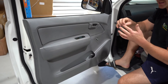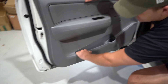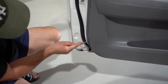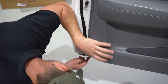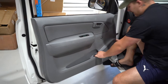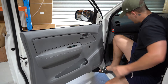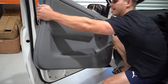Bring the whole coin pocket out, again making sure you don't lose anything. Now run your hand around the edge — be careful not to catch any glass on your finger and cut yourself. Then use a flathead, come over to the corner, and stab the flathead in the most hidden space possible without damaging anything. If you've got smashed glass you're going to have glass all over the floor. See how it just pops off like that — now that it's begun popping off, pop it all the way up and take this black trim off. It's just a pull-off — place it on the ground.